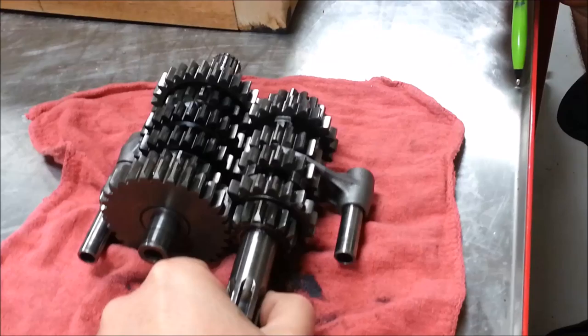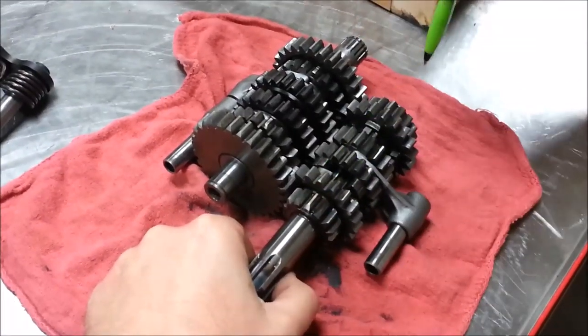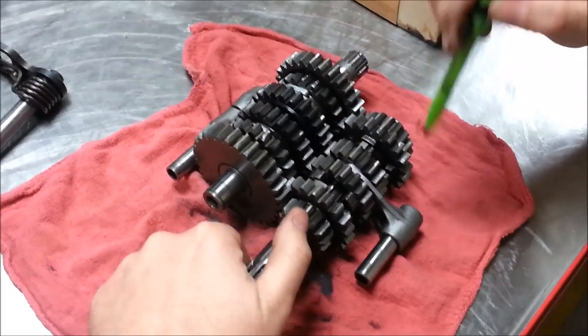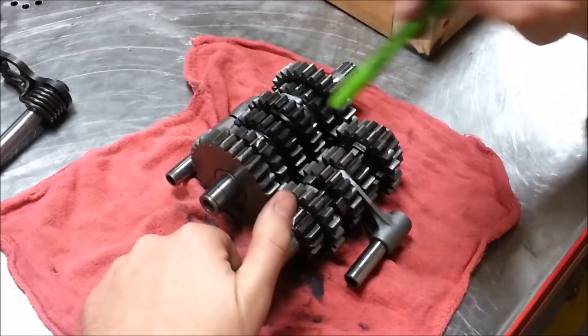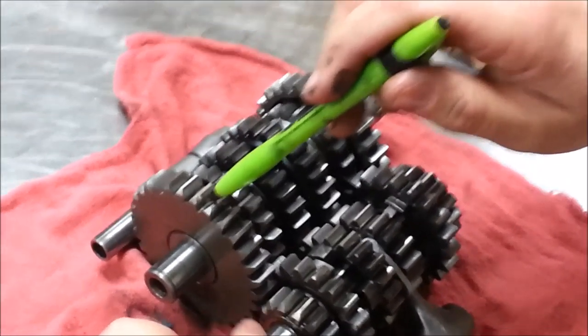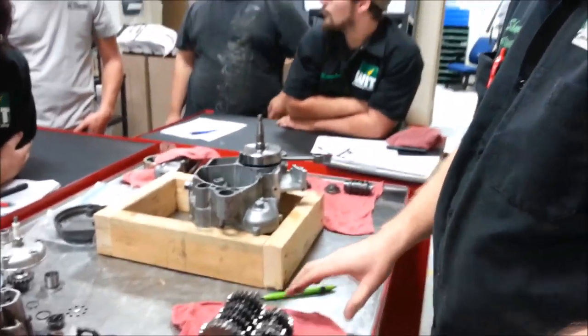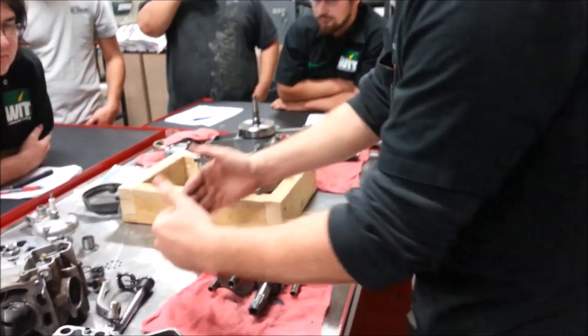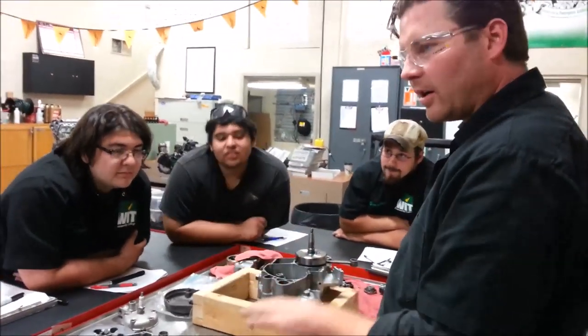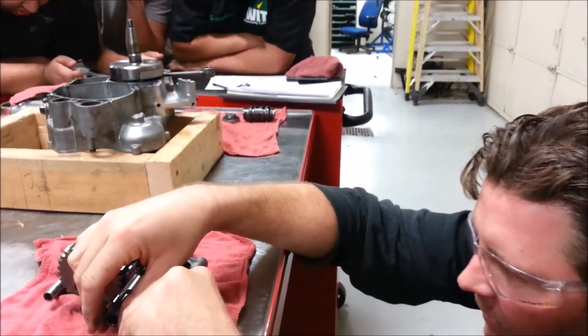Getting down to eye level, I can go first, second, third, fourth, fifth, sixth gear. They're staggered because that's how the shift cam and drum are able to connect the gears through the star pattern. From the countershaft side, the gears have a more noticeable size difference and are easier to read. Largest on the countershaft is first, then going the other direction: second, third, fourth, fifth, and sixth. In the future we'll lay your transmissions out, put a piece of paper underneath, and you'll write out each gear position — and they should match on both sides.